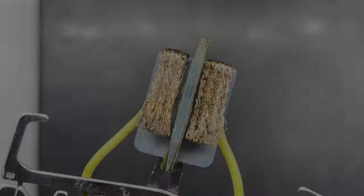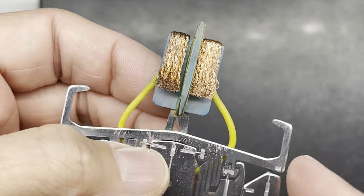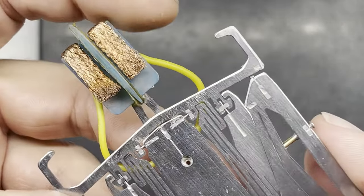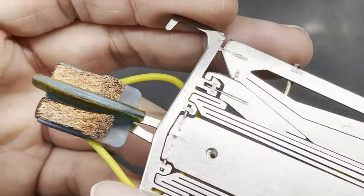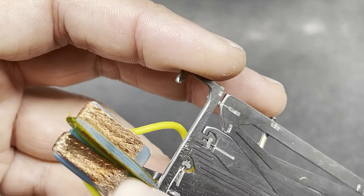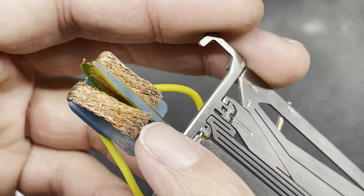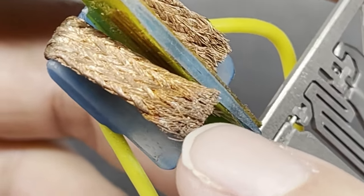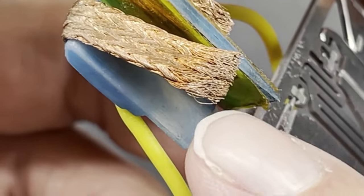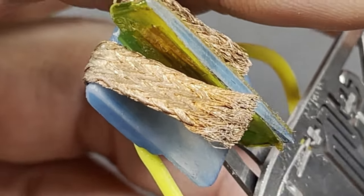And the problem was these things here, these braids at the front of the car. Now these are not the actual braids that I used in the race. I've changed them since because we've had a round of the British Open Championship since, and I prepared this car for that event. But you can see the start of what can possibly happen. Look at the end of this braid here, can you see how it started to burn a bit? But it started occasionally to weld itself together on the end here. Some of the copper tends to stick to other bits of copper. Rather than it being all the individual strands, it tends to sort of weld itself and go hard.